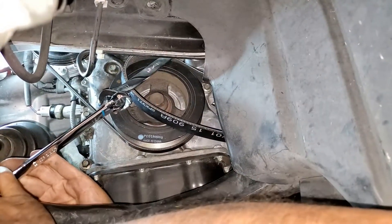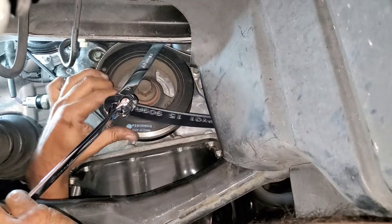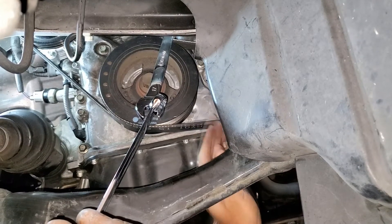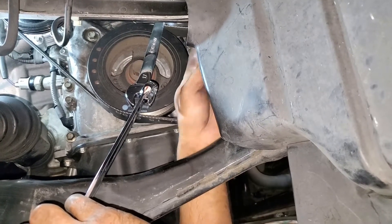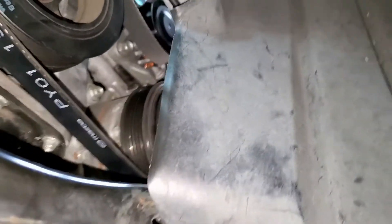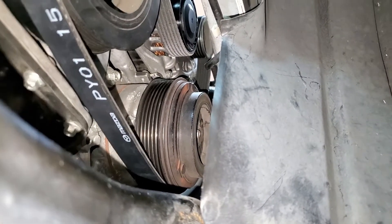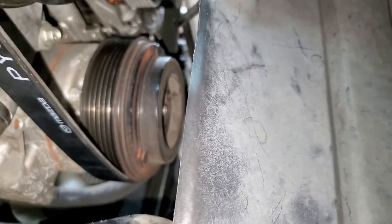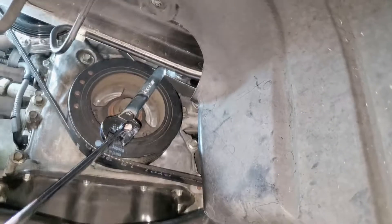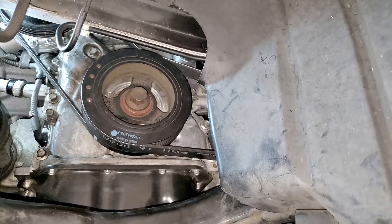I've got the belt tensioner engaged with the wrench. The belt is going over the alternator at the top, wrapping underneath the black pulley, then pulled over to center underneath the AC compressor, and from the side view it's going across the face of the crank pulley. I've got another wrench connected as a lever arm — pulling it toward the front of the vehicle to slide the belt onto the crank pulley. I pulled the belt into place on the black pulley, and it's now aligned. Everything looks good on the alternator, the AC, and the crank pulley. We let go of the wrenches, remove them, and everything is installed.